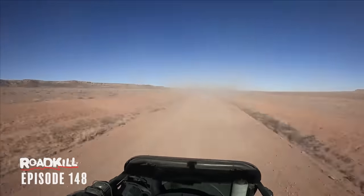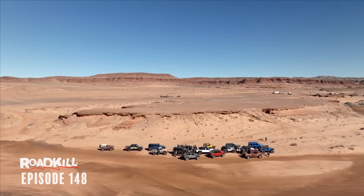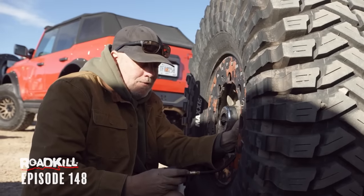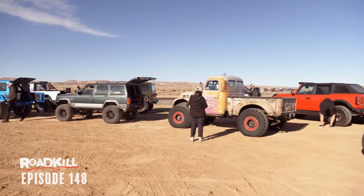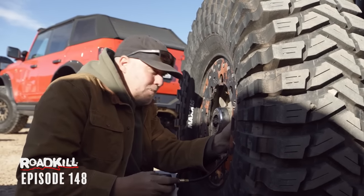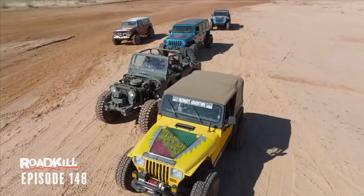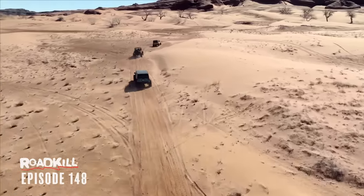It was about 40 minutes in there — big, long, dusty road. We're the only Jeep with no top, so we're all covered with dust and everything, which Cotton has never experienced. Everyone's airing their tires down — you do that for better ride quality and more traction. Dave told me that these Trepadors tend to pop the inside bead because the sidewall's so stiff, but it's got a bead lock on the outside. He said I probably shouldn't go to five pounds, so I'm going to nine.